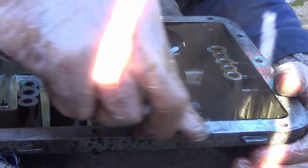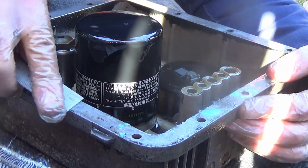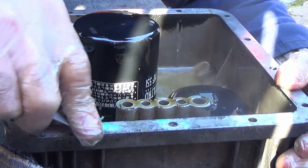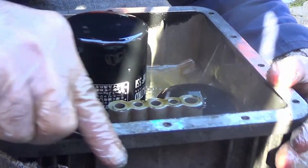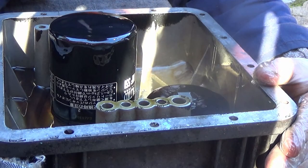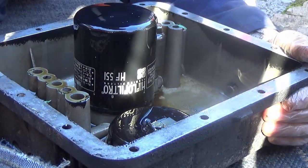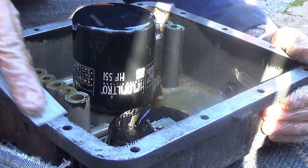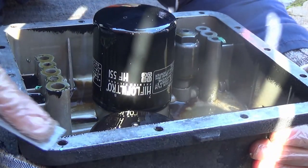You can still see some remains of a previous gasket - see the black writing on it. You want this surface as clean as possible and as flat as possible, and don't want any gouges in it. This also highlights any high spots, and it will scrape off the top of the high spot.